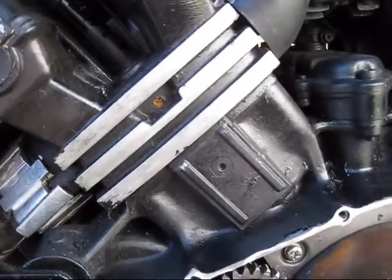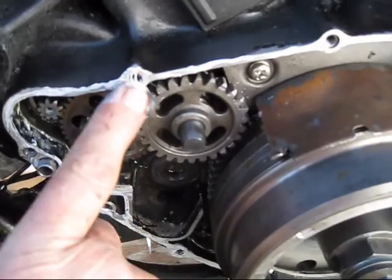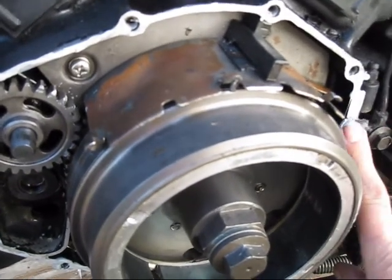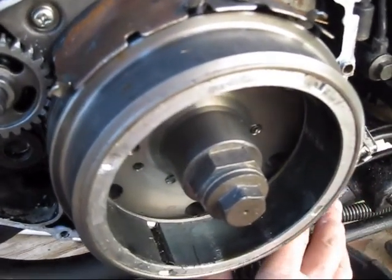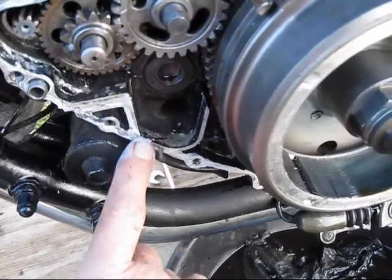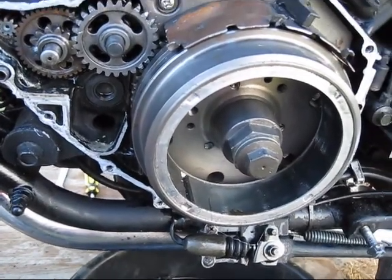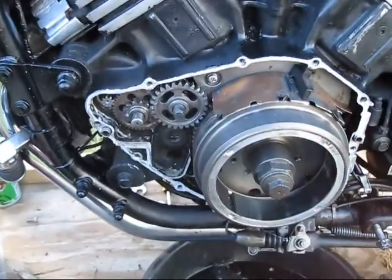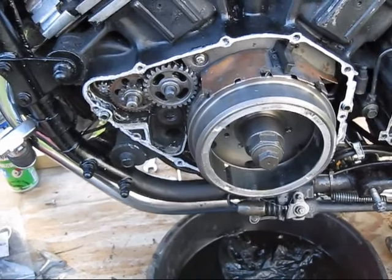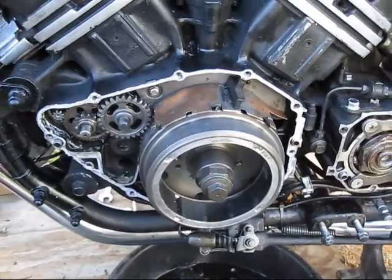This thing had a lot of silicone in it — that's probably one of the worst things you can put on a motor, especially a Japanese aluminum motor, because the oil passages are so small, not like a car. You wind up getting silicone all over in your motor and plugging stuff up. This is Three Bond gray gasket maker — Yamaha's version I think. If you use this stuff, I guarantee you won't be taking the motor apart to fix an oil leak.